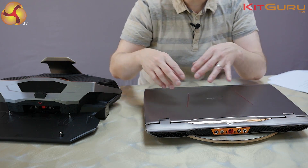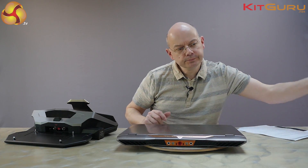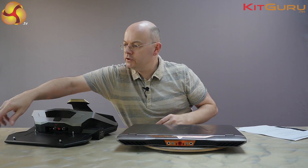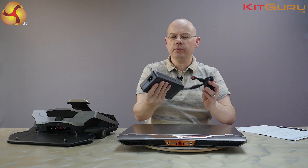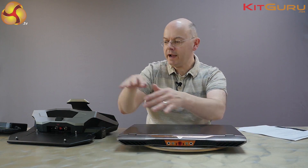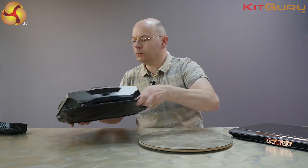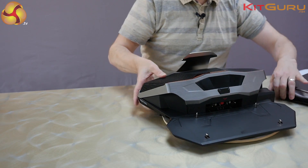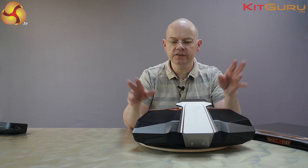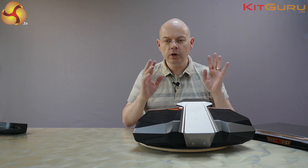We have two locating cones for the dock and then the red connector which is where your power comes in. Ordinarily with your regular power brick you connect that to the red when using it as a regular laptop. If you're switching over to the dock, you use this different 300-watt power brick which connects to the side of the dock, and then when you put the laptop in the dock you run the power from the dock through the laptop. The dock has a liquid cooling pump, and under these grills we've got a pair of 92mm radiators with fans. The liquid is pumped from the laptop - all is happy.